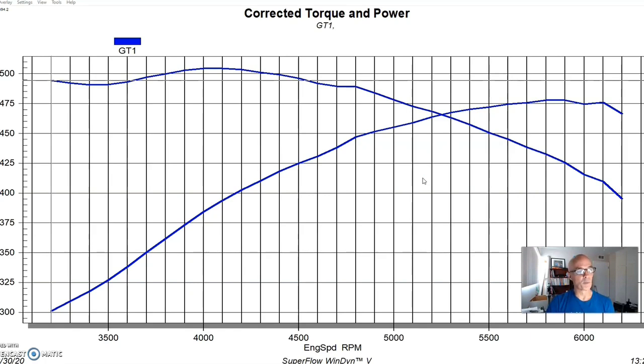I liked this crate motor because it ran good, we beat the heck out of it, and we never had any problems until we did something dumb and hurt it. What I wanted to do back then was test the then-new Z304 heads from Ford Racing. Ford had a number of different heads available for the small block Ford Windsor family — basically the GT40 line: the GT40P, the standard GT40 aluminum head, the GT40X head which came on this motor, and then they introduced the Z head, which was a big step up from the GT40.